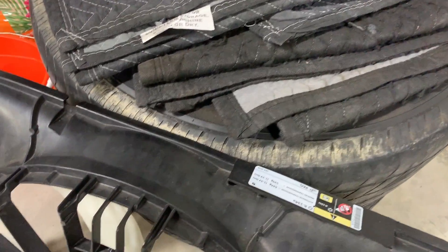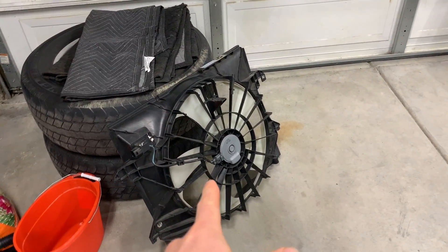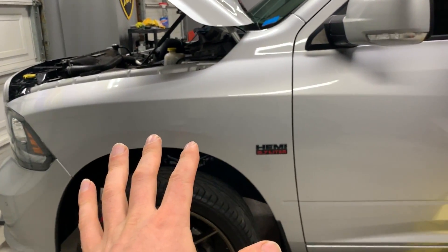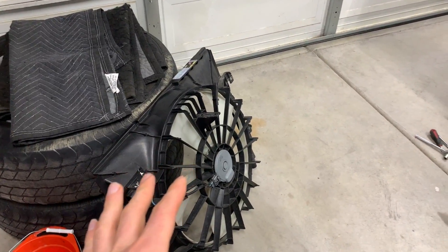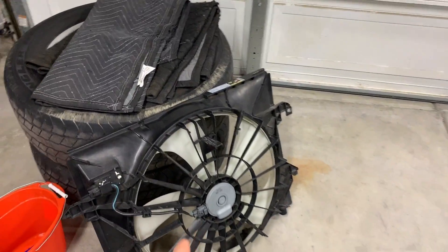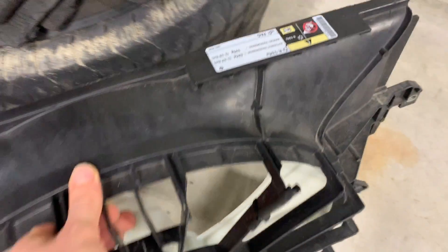This is where this comes into play. This electric fan is a direct replacement for all that stuff you see there. This is a V6 version fan from a fourth gen Ram. If you get a fourth gen Ram — meaning 2009 to 2018 — with a V6 engine, that fan will be on it, there will be no mechanical fan. This is actually an OEM Mopar unit — you can see it's still got the refrigerant sticker and all that on it.